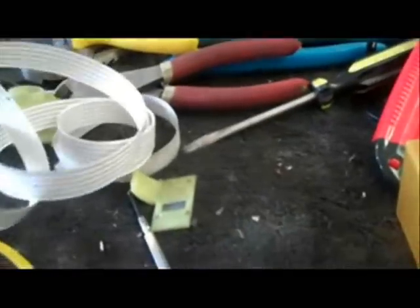I'm going to see if I can fix that. I've fooled around with it for a little while and it looks like you could repair it if you want to, but I already put the new one in so I'm just not going to worry about it. But if you could get these ends stripped clean of the copper just like this one is, you could probably just clamp it in there or solder it in, and that would be a pretty good way to save yourself some money. The new one was like 60 bucks for an off-brand one - this is the original Ford one, so if you could figure out a way to fix this, you could save yourself quite a bit of money.